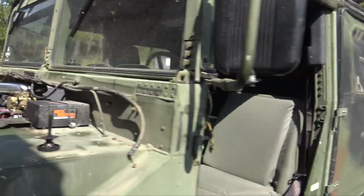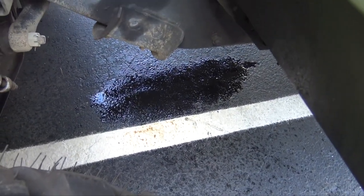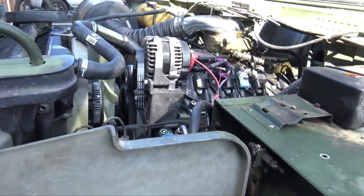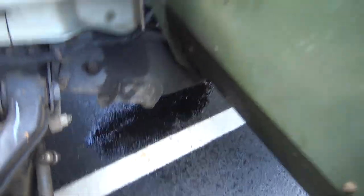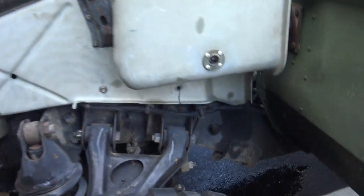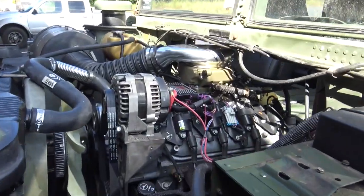So I've bled the system one time. Huge air bubbles came out — I'd get it almost to lock and it would literally just pour out, bubbling like a witch's cauldron. I think it's gonna help but I don't think I did it long enough — only about 20 to 30 turns. That's a lot of fluid that popped out of there. I checked it and it's on full cold. I'm gonna drive it a little bit and see how it does. I'll probably have to do this three or four more times unless you comment below and tell me a quicker way.